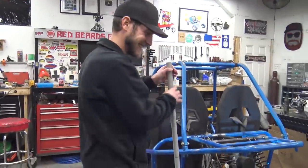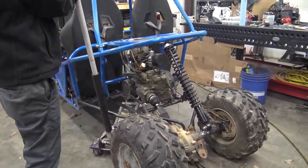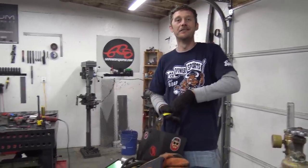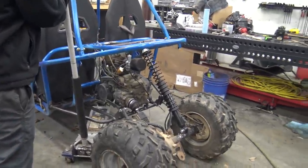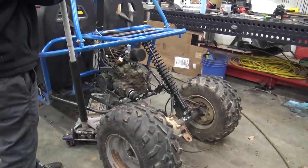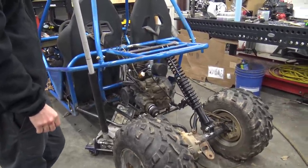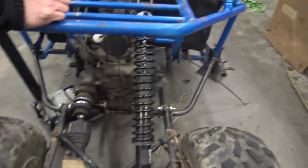Easy, don't be hammer slamming it. Alright, let's make your guesses — I think it's going to be perfect. I think it's going to be too soft. I think it's going to bottom out. I think it's going to be 1,000 great — that's the positivity we need! Slow and steady. There's some wheel crunching — watch inside. It's too soft, it's not going to catch it at all. So if we can find a way to add a second one — we don't have much real estate — we can cut this shock tab off and put our new ones on. We'll have to move that one over too. We'll get to cutting and grinding and we'll show you what happens.